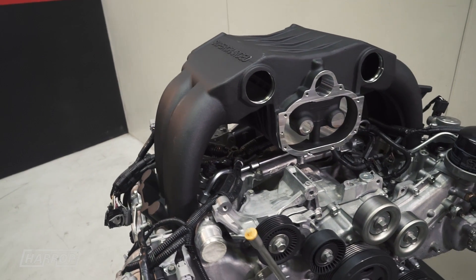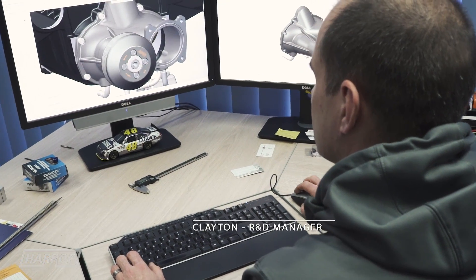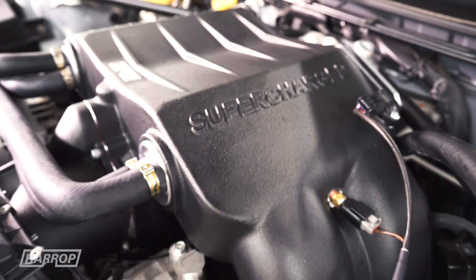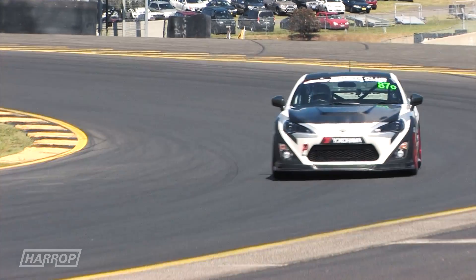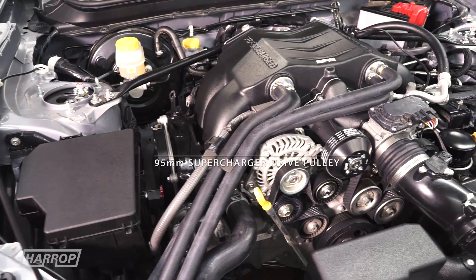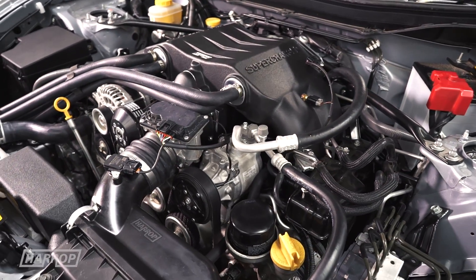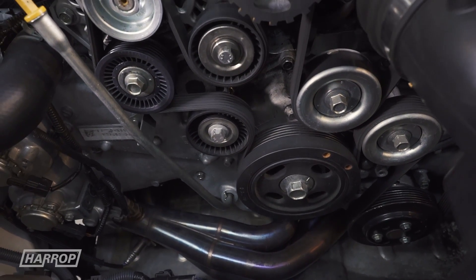Moving to the supercharger design, we have delivered clean air to the supercharger. We have utilized the front drive front inlet, or FDFI 1320 supercharger for the FA20 engine, capable of supporting a standard engine right through to built motors for extreme performance. For standard installations, the drive pulley supplied is 95mm and uses a longer 6pk belt, using the factory front end accessory drive assembly and an additional supplied idler pulley to achieve the necessary belt wrap.